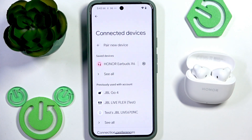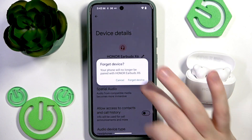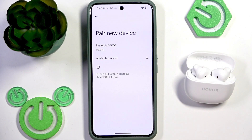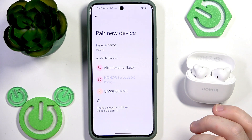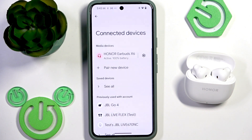After the factory reset, remove the earbuds from your phone. Click the information icon or settings icon, then Forget and confirm. If you have Android, click Pair New Device. After a factory reset the earbuds will enter pairing mode automatically, so just tap on them in the device list and click Pair. That's it.